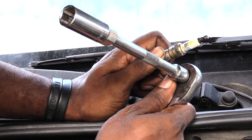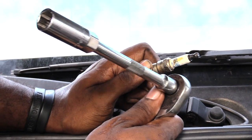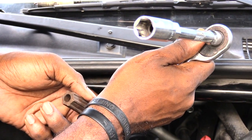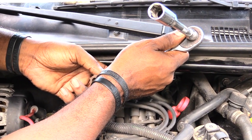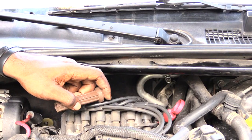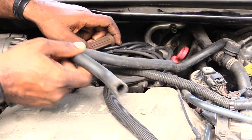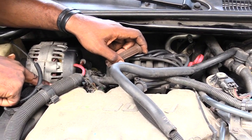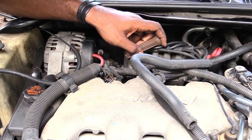This is how you change out your spark plugs on a 2000 Chevy Impala — it's probably the same from about 2000 up to 2005. Just like the front, take out one, put the new one in, check your wire, replace it, then go to the next one. That way you don't get your wires crossed. Once you're done, don't forget to reconnect these pipes — this big one goes right here on your engine and this small one goes right here on this little piece. Please check out our other videos and subscribe, thanks.